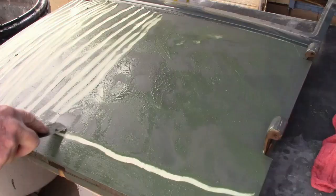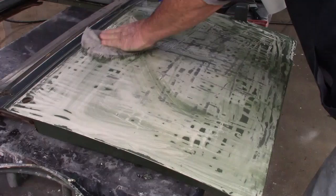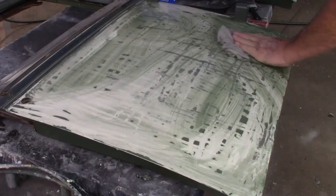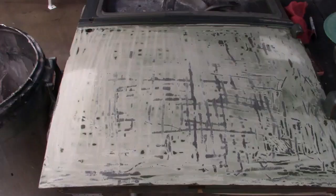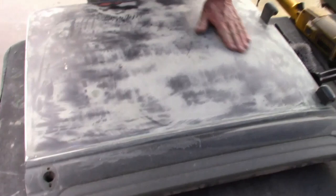The acetone makes it easier to scrape. That took most of the paint off. The rest is being removed with a rag and more acetone. I'll point out that he's doing all of this on a cold, rainy day because acetone evaporates fast in warm weather. Anything else is ground off using a 40-grit disc with a soft backing, so it leaves a smooth finish.